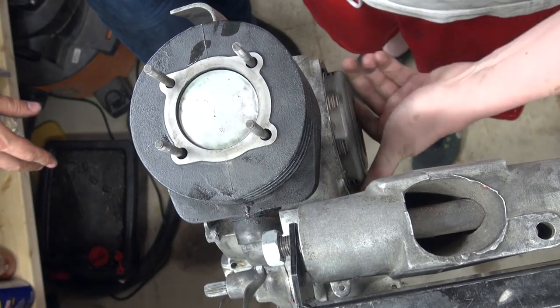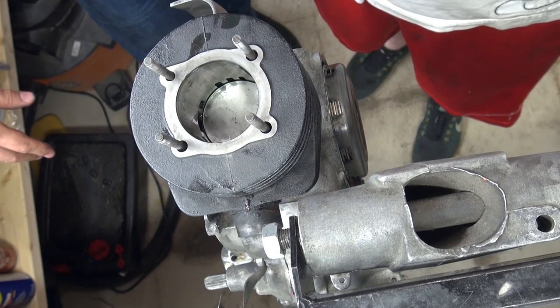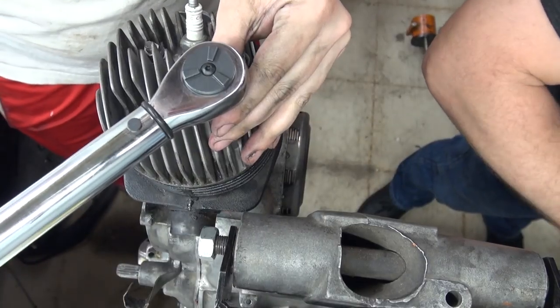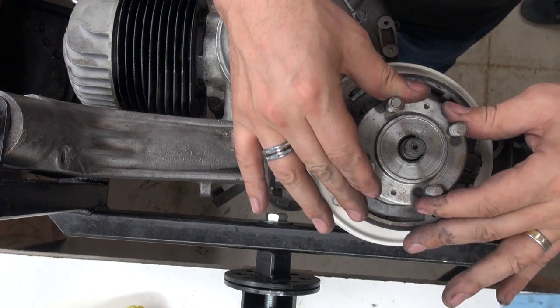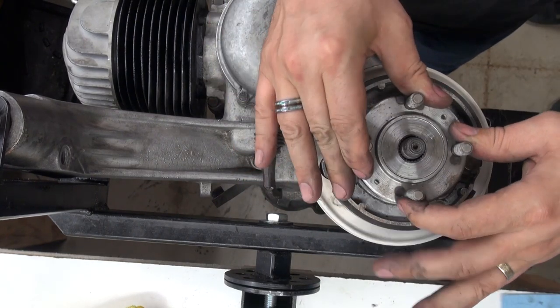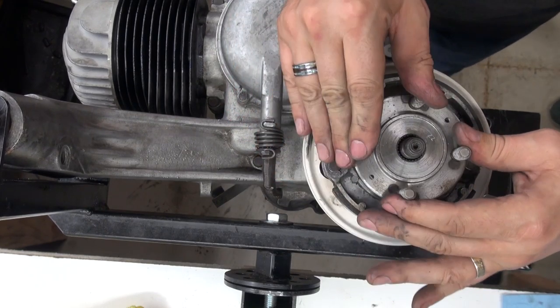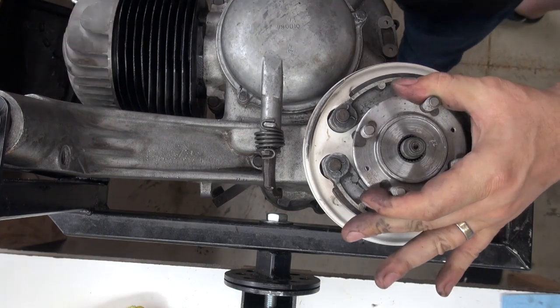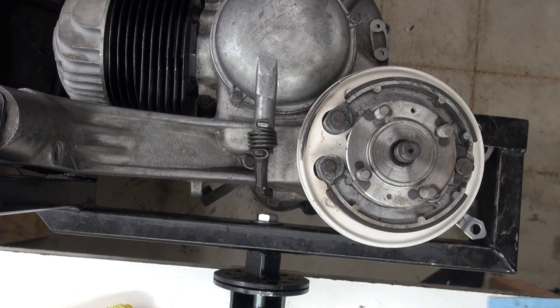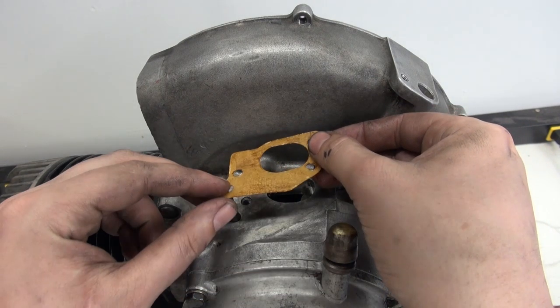We reused the cylinder that was mounted on it — it's a DR-177 — but we reworked it to get some higher exhaust port timings. Now converting a Veloce engine to 8-inch is not that hard; all you gotta do is just mount an 8-inch hub, which as you can see here is one of those stainless steel hubs that come on most VBBs, VNBs, Allstates, and so on.